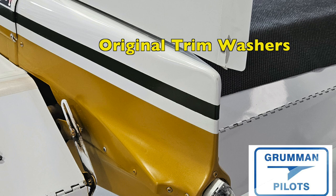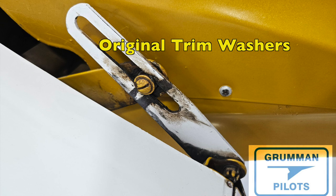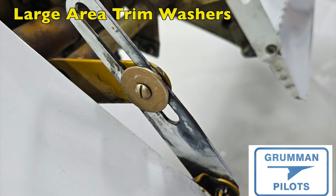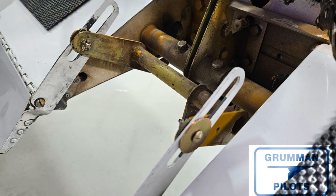Being annualed in 2023 makes this a 47-year-old airplane. It still had the original trim washers from the factory on the elevator trim. These work, but as things wear they can jam and slip. Everybody's pretty much gone over to the large area washers — we're using an AN970-4 in place of that little washer. It rides a lot nicer on the outside of the bracket and won't wear. The roller and bushing inside were very dirty from 47 years of lubrication without being taken apart and cleaned. Here it is reassembled with the large area trim washers — everything's cleaned and it won't jam.